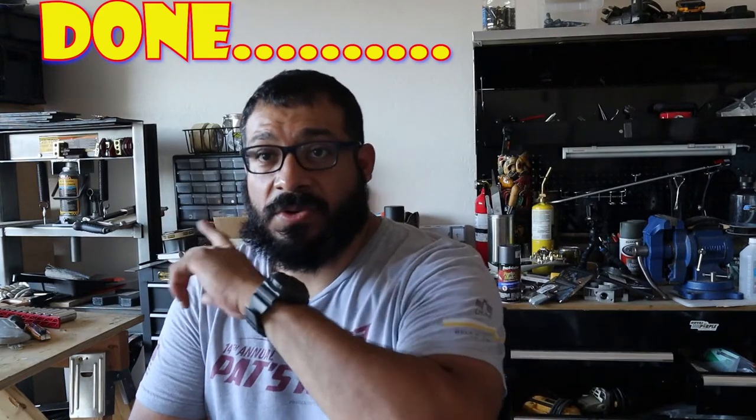All right guys, so that's how you restore your headlights on a 2008 to 2010 Dodge Dakota using the Chris Fix method of some sandpaper, some clear coat, some wax, some rags, and a little bit of elbow grease, and it actually came out really well. The small fractures I showed in the video didn't really come out, but it's still way better than it was before. I also noticed a haze on the inside of the plastic, which is someplace I can't reach to fix. But compared to what they were before, 100 times better, especially when this only cost me $40 compared to $134 per headlight. So I do recommend you guys doing it.